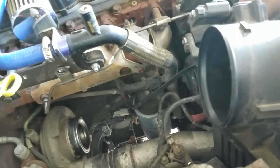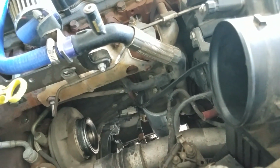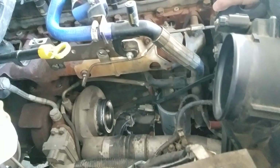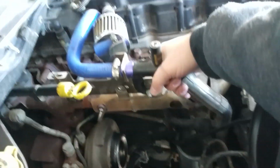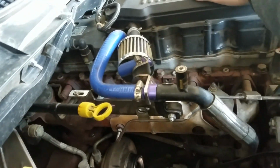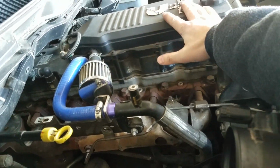And here, some people may be wondering, I've got a cord here. That's my block heater cord. I've had it plugged in all night. Actually helps with this, so doing the oil change isn't so bad. Yeah, it heats the coolant up, but the oil is also a bit warm. And I know you can't feel this obviously through the video, but this tube is very warm. I mean, even the top of the motor right now, engine, is warm.